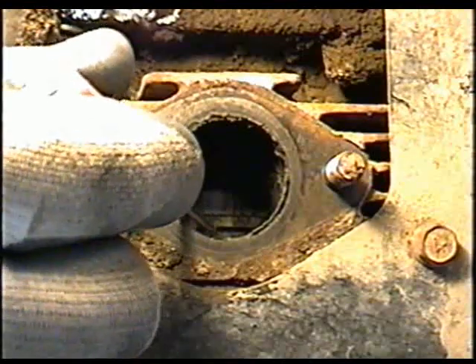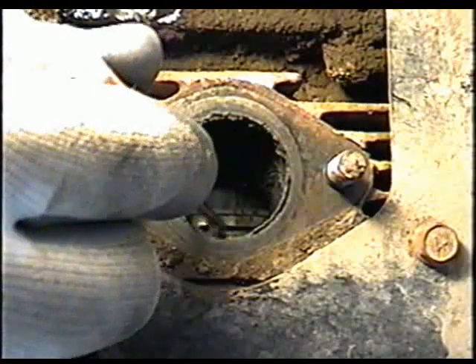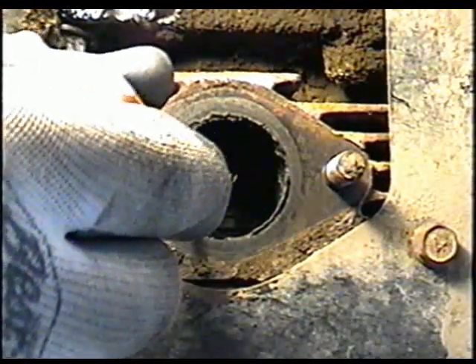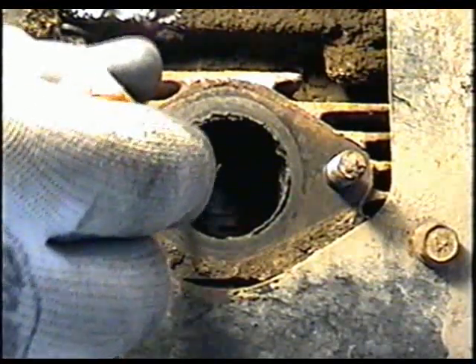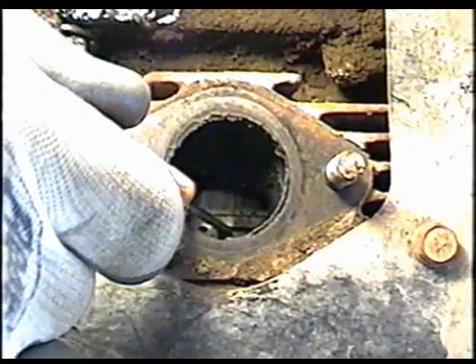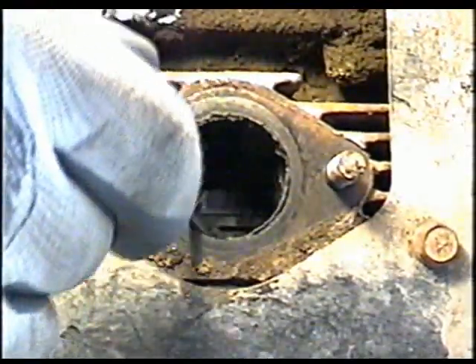Here's a better view of the bore in the cylinder and the piston. Look at that — loose on the sides, up and down. The ring looks scored a bit. This ring is totally missing; I can even put my screwdriver in the groove. There's a lot of carbon on the exhaust port, and you can see it's been leaking around the base gasket — there's a bit of oil and the dust has stuck on it over the years.